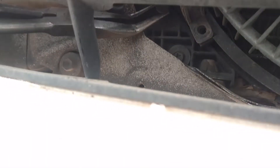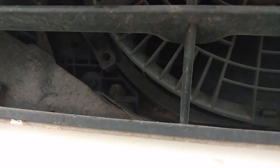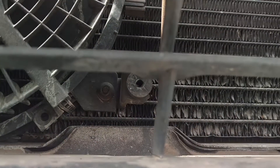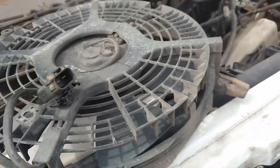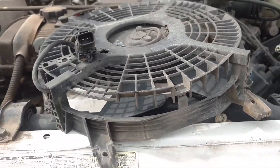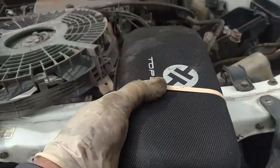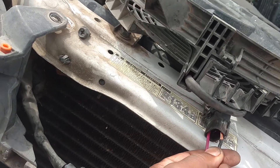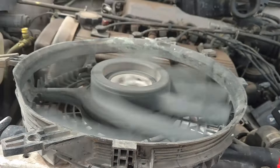See how that comes out. Now that fan should slide, hopefully, toward the driver's side and out of there. A little support brace grabbing on it. Now that I have it out, I'm going to take my jump box and test it — put some positive and negative power on it, make sure it works. See the fan turns, nice and fast.